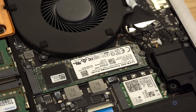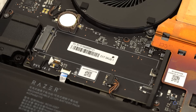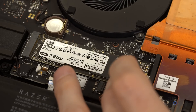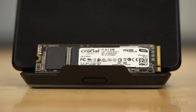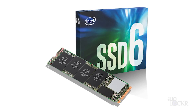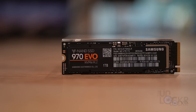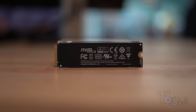For the SSD, you need at least one M.2 PCIe NVMe SSD. There are two slots, so I'm going to install a 1TB SSD in the empty slot first, which combined with the 512GB already in there gives a total of 1.5TB. There's also a 2TB affordable one from Intel linked below, and you can buy two of those to get 4TB in total. If you want a more name-brand model, there's the go-to that everybody uses — the Samsung 970 EVO SSD, also linked below.